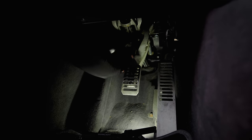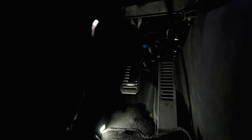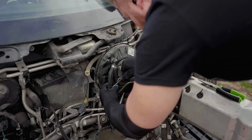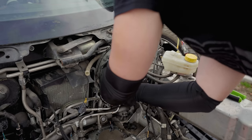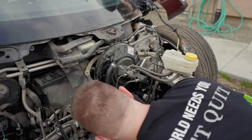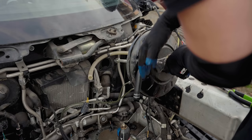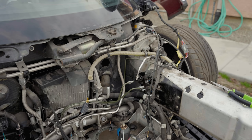There's a little clip here connecting the linkage to the brake pedal, then three bolts, and it should come off from the front. It's really tight working in here but that's the name of the game. That was the easiest thing I've ever done in my entire life. No idea how these clips work but apparently they're fairly common — I couldn't find anything on YouTube though. Let's go — there's lots of brake fluid in there still. First time taking out a brake booster from a car!